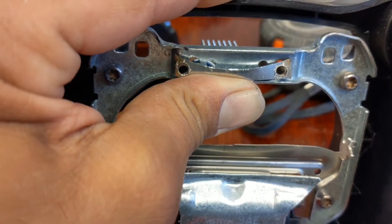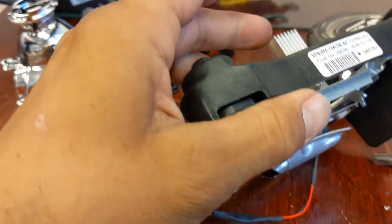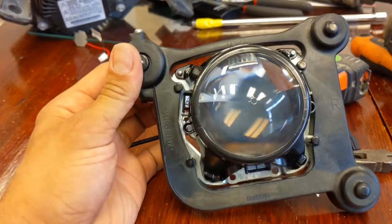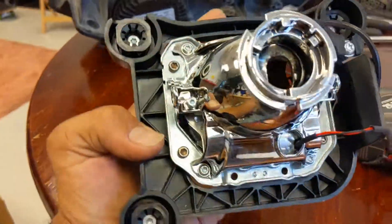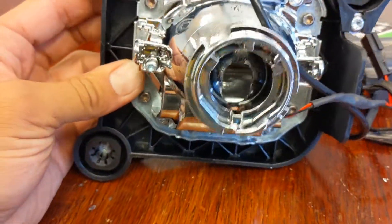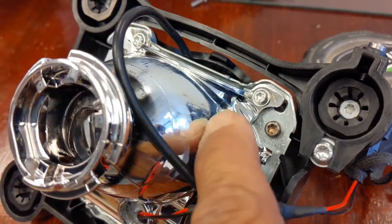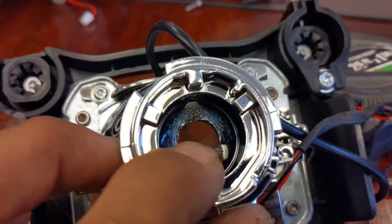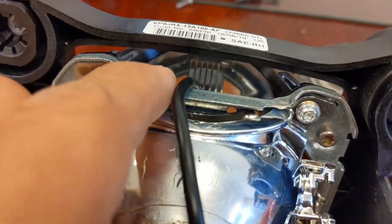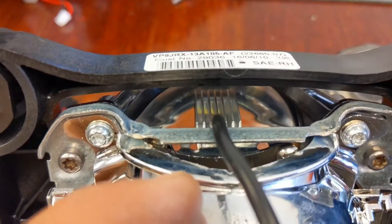Test fit your lens. The chip is now installed — looks nice. Make sure it's secure and your nuts are tightened. Now put our lens and housing back together and put the four screws back on. Run the wire out the top and the other wire out the hole it's supposed to go through, then put the headlight bulb back in. I did notice some burning on the inside of this chrome piece — it gets really hot in there. Make sure the new chip isn't touching anything, because that fin piece on top is a heat sink and it will get hot.